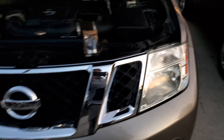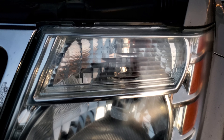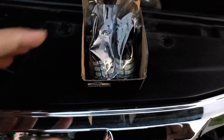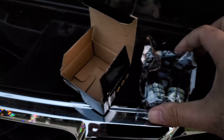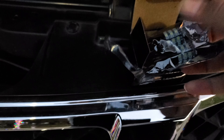I decided to order LED turn signal bulbs. My turn signal indicator has a clear plastic housing, so the bulb itself needs to be orange or amber. I purchased this one — it comes with two bulbs. I asked the seller specifically and they confirmed it fits the front turn signal. The brand is Parts AM Lighting Accessories and it was around $15.99. I'm going to install one to see how it looks.